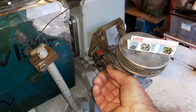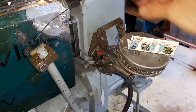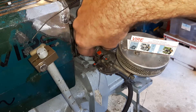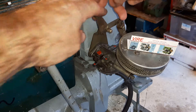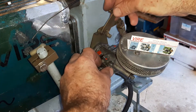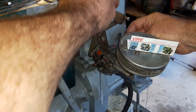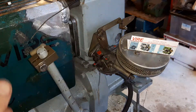It means you can change the angle of this lever to however you want it. Normally on an engine you have this bracket which holds — I call these quadrants. Your cable from upstairs comes and controls this, and you have a wire connected between the two. So this will operate the choke, and this one connected to the throttle lever. This allows you to pull the choke on without opening up the engine.